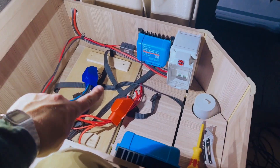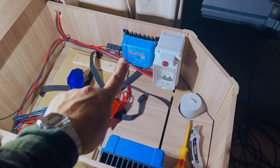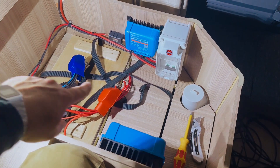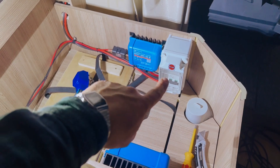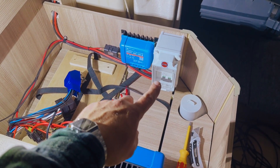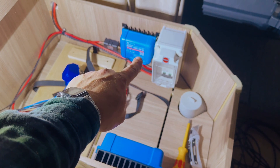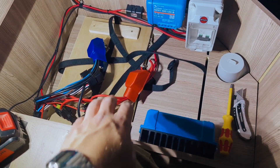Progress so far: we've closed off that box, tidied up all the wiring, and put everything away in there. We've got the solar charge controller connected up — that's the output line with the fuse there, which wraps around, and then we've got the PV coming in from the panels. Both of them go into the bottom of the DC circuit breaker. The PV lines go into the top of the circuit breaker, then come out of the bottom into the charge controller, and then out of the charge controller onto that output line.